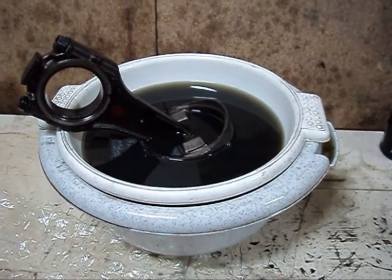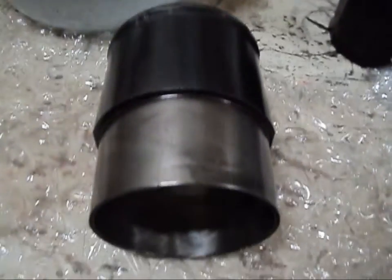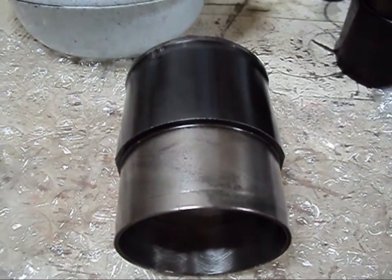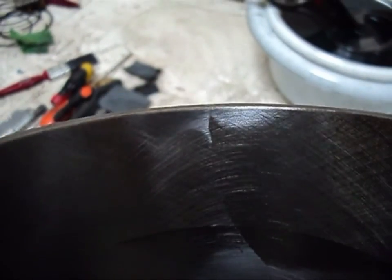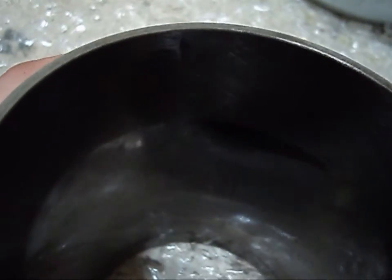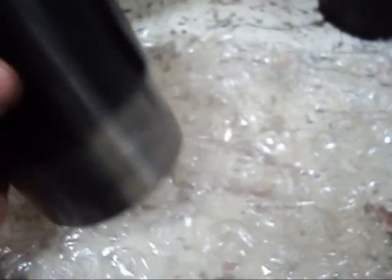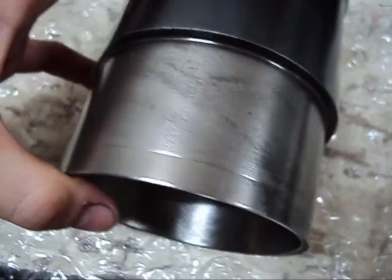By cleaning parts such as these you're going to encounter major issues from time to time. In this case, since the liners were not polished from the outside, upon cleaning this one over here it seems to have a crack which is very visible all the way up to the scraper ring. The crack is not a surface crack but goes right through — very obvious when you look at the inside. This type of crack usually occurs when the metal has undergone excessive heat, most likely when the engine overheated at some point. So I now have to look for a new sleeve to replace this one.